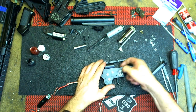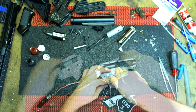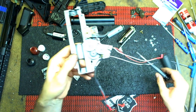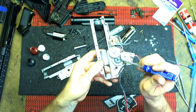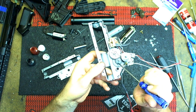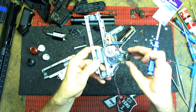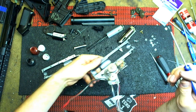If you open this up real quick — that's what we're looking for. You have a thin layer of grease on the top plate and a thin layer here. If there's no grease there, that means this gear and this gear are too close and just scraping it off. The thin layer there, that's good. You have a little on the top here, so it's meshing. And on the bottom you have an even amount, so that's good. Then just go ahead and close it up — gear set's good. Let me pack the rest of the bearings and done.